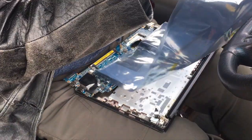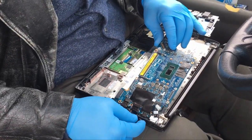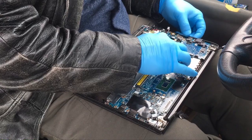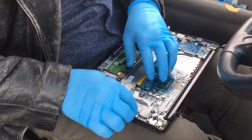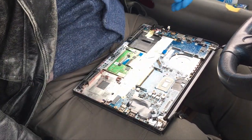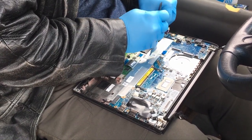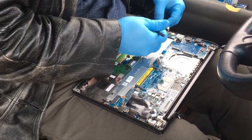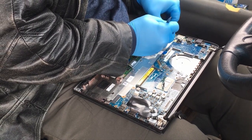When seating the new board back down, make sure you take note of where all the cables are, because it's very easy to get them pressed down underneath the edges of the system board. I had one wire that was a little bit underneath it, which is what I'm adjusting for here, and I also pulled a flat ribbon cable out from underneath it. Just be very aware of that when you put these back together.